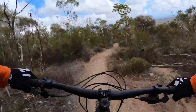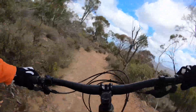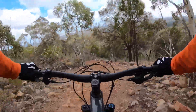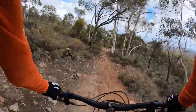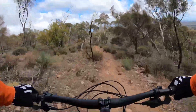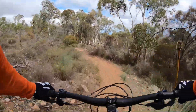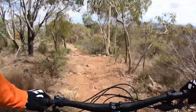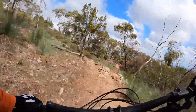We've got two turns of preload on that spring from the back, so that's minimum. RockShox recommends two to five. Feels quite good. It is probably a little over-sprung, but it's not terrible.